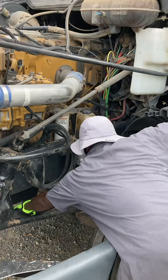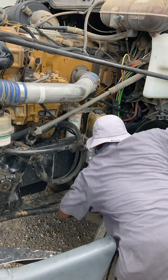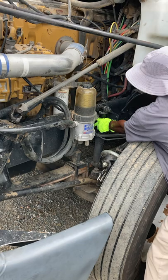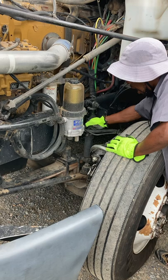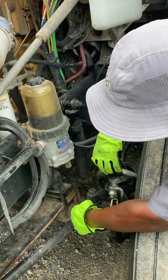My leaf spring is not missing, shifted, cracked, broken. My U-bolts, there's no broken, loose, or missing bolt. My shock absorber is securely mounted, not leaking. Brake hoses and lines, not cracked, worn, or frayed. All couplings and fittings are secure, not leaking, and it can supply air. My brake chamber is securely mounted, not leaking, has no cracks or dents, and no loose or missing clamps.